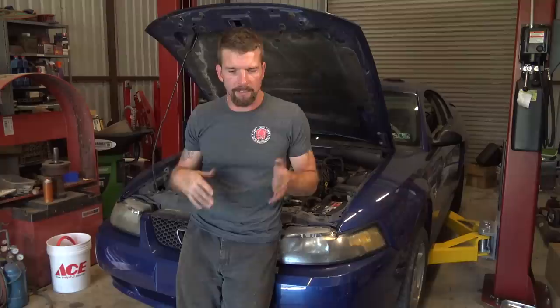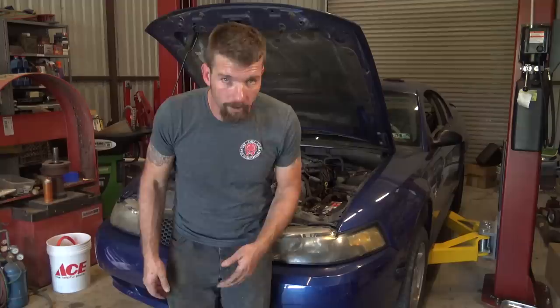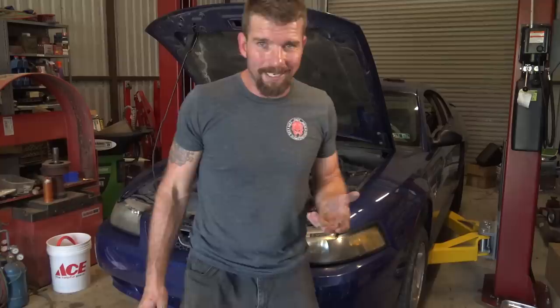While I was working on it, I heard a slow-to-crank condition — it was cranking but taking too long. A couple of weeks went by, she called, battery was dead, put a new battery in. After the engine spins over for about one or two seconds it should start. This one was sitting there cranking for about eight to ten seconds.